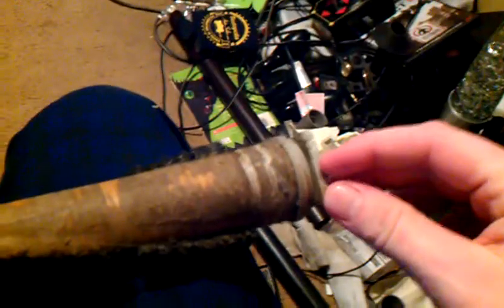First, we want to talk about the adjustment of the brush roll itself. If your brush roll is set to the lowest setting, which would be number one on the brush roll — I've got a brush roll here on the ground — that's going to be its lowest setting, which would be number one. As you can see, both sides are on the lowest setting. You do not want to run it on its lowest setting, because you can actually burn your belt in half.